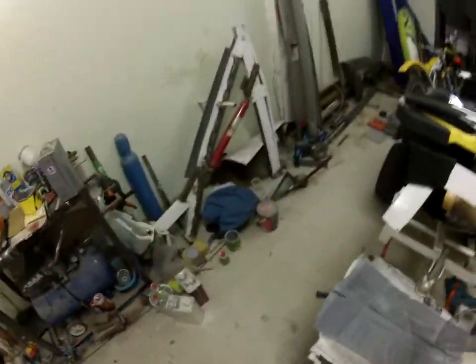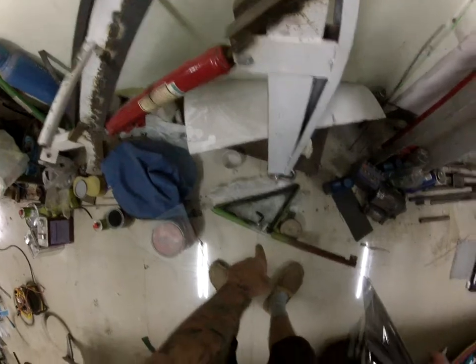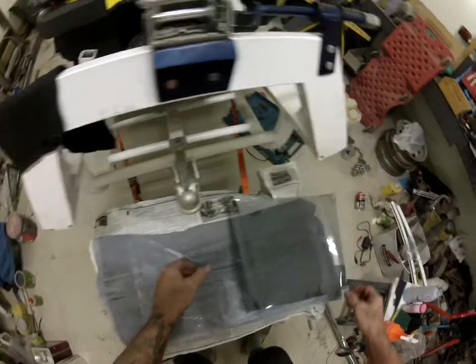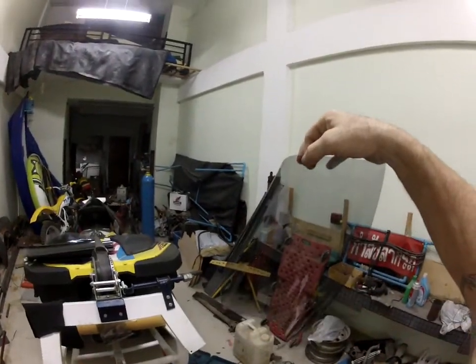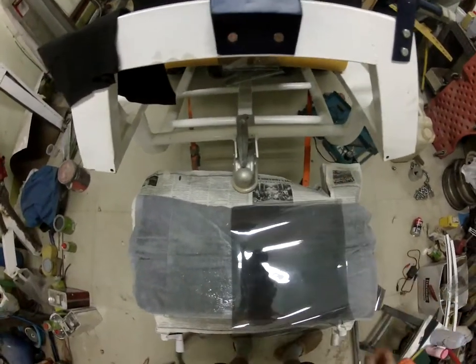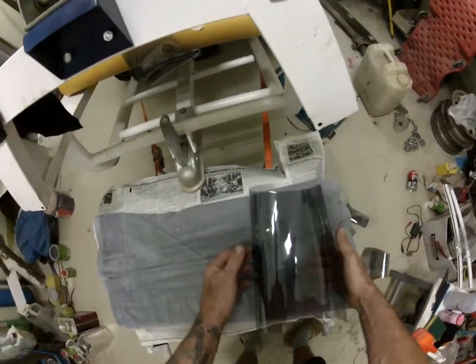These tiny little pieces are just enough to do one of them quarter lights there. But I know damn well from thousands of experiences that those will not come out right first time round. So I am now going to use this tiny little piece of film on this rear quarter. The other ball ache, like I explained in my other videos, is this film has a grain in it. What that means is it's got a weave, a grain, a pattern — it will only shrink up or down. There's no way of me telling which orientation it's in, to be honest.